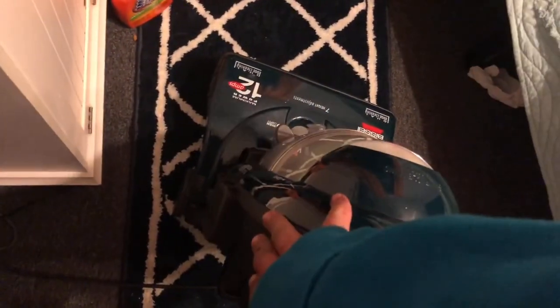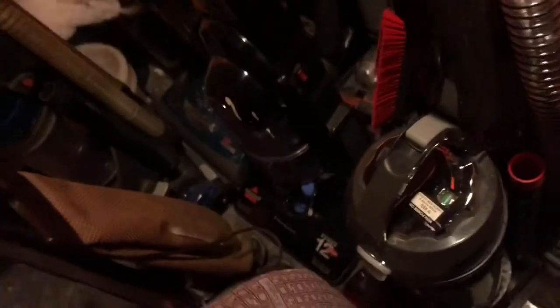This one, you can hear the brush roll does sound decent. It has a little bit of vibrating to the brush roll, but not too horrible. It'll at least be better than the one in this CleanView, and then this one will just get a brand new brush roll, because these bristles are really good. This brush roll functionally is new, but the bearings are a little worn. This one: bearing shot, end cap shot, bristle shot. This thing barely cleans anymore. When I do use it, it's basically just for fun, because I like how it works. It's just a nice machine to use.